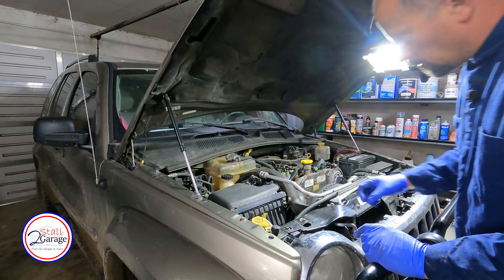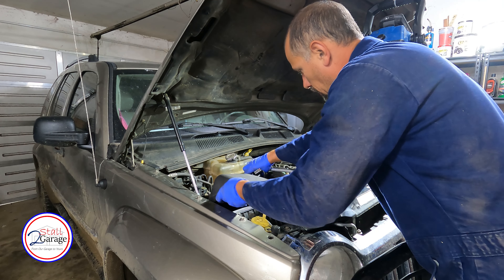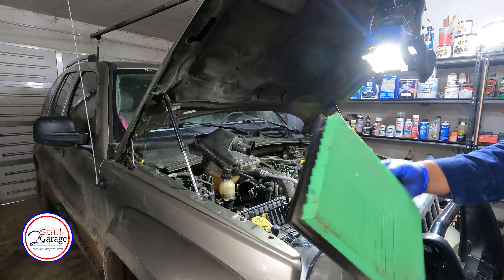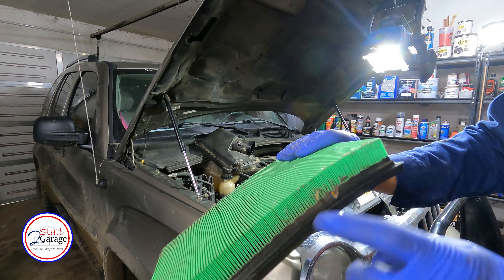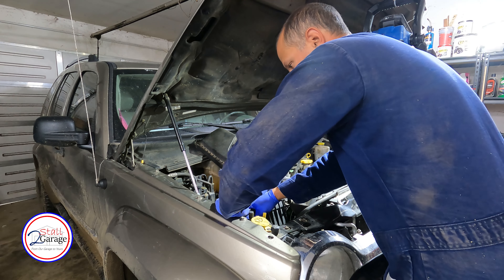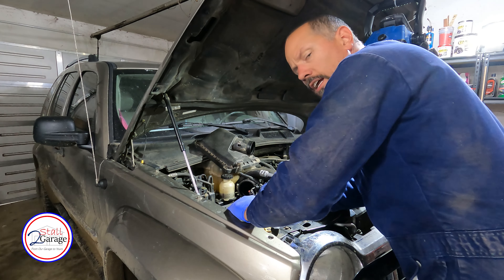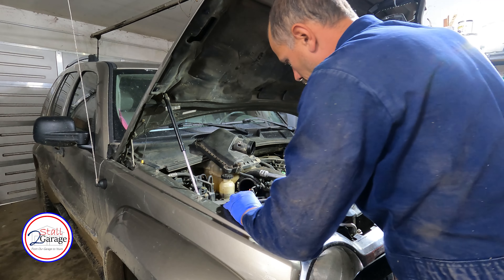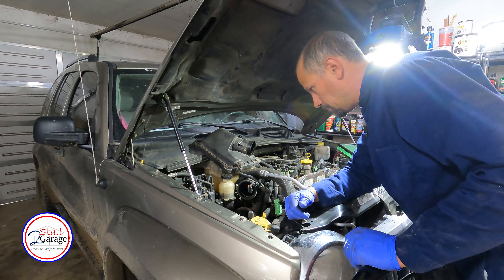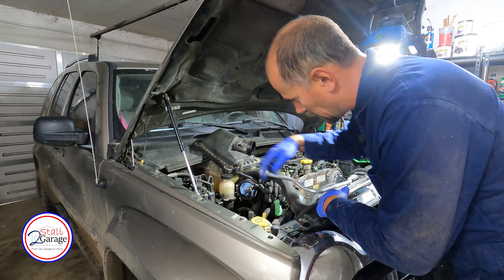While that's draining, I've undone the two straps that hold the airbox on and disconnected the mass airflow sensor. Now I'm going to take this out and set that right up on the engine. Got our micro air filter — catches a lot of stuff. Always have an air filter on no matter what. I'm going to take the airbox off — this just comes out with gentle pressure, pulling up slightly. Turn it sideways, take it out. I'm going to go ahead and plug the turbo hose so we don't get anything down in there.